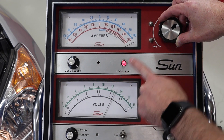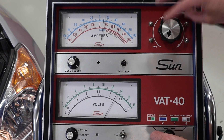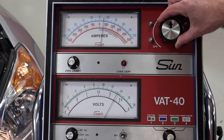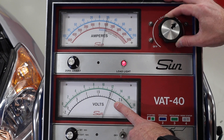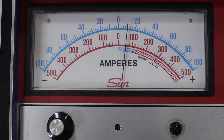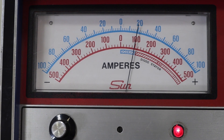In our case that's about 12, 12.1 volts. We don't want to go lower than that because at that point we'd be taking from the battery. When we do this, we exceeded our 100-amp scale, switched scales, repeated the test, and it looks like on this Toyota we're getting about 100 amps out of the system. We'd compare this to the specification or rated output.